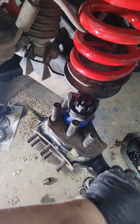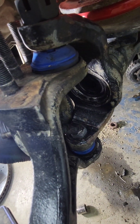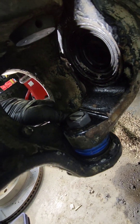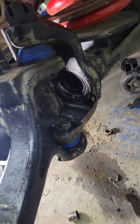One more important thing: you have to grind the top of the lower ball joint flush with the nut once you install them. Get it tightened up, grind it flush, or the RCV will interfere.